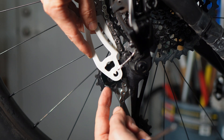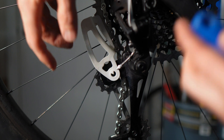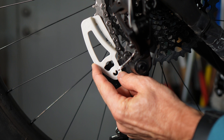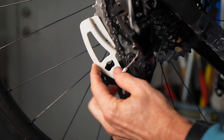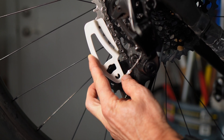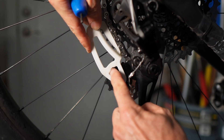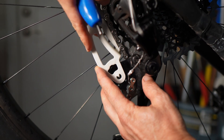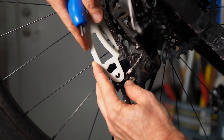In this case, my derailleur is too far away from my cassette. So I'm going to turn my B-Screw counterclockwise, moving the derailleur closer to the cassette. As I do, you can see it coming in. And then I want to make it align in the center of that window — push down, make sure it's still making contact with the jockey wheel, and also make sure the tool is onto the cassette. And that is looking good.